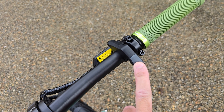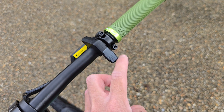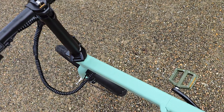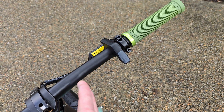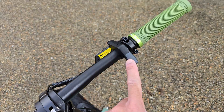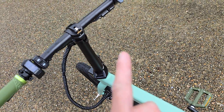The only problem is at the locked 3.5 MPH rate there's no torque in it. So if you're trying to go uphill and don't want to pedal, you can't do that uphill on the throttle alone because there's not enough torque at that low speed — you have to unlock it. Then you get the ability to use full torque uphill with just electric, which is really quite handy.